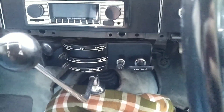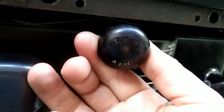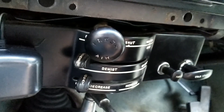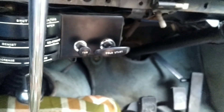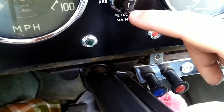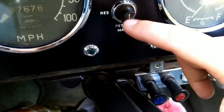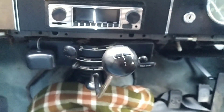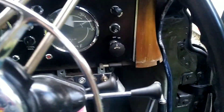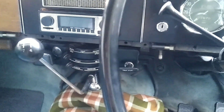That trick of putting white paint on the lettering will work on any of your switches — you don't have to take them out. While I've got the paint out I'll blob some on here, wipe with some white spirit and it'll look just as nice. Do the same with the gear stick, lamp switches — look at this little arrow. The oil level switch looks like someone's tried painting it and done a rubbish job. Any of those you can freshen up with some of that paint.